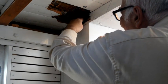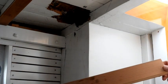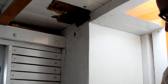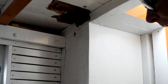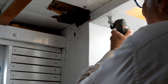There's just nothing left up there — it's completely rotted out. So that's going to be the next job: I'll mark up one side and then laminate it to another piece of the same stuff to get my thickness, and then plane the other side to match the curve. So I'm going to work on taking a little more of this wood out today to get an idea of exactly what I've got to look forward to. Since this deck beam obviously has no strength I'm going to cut a little bit more of it out. And it doesn't appear, at least here, that the planking was even attached to it.